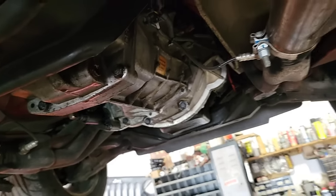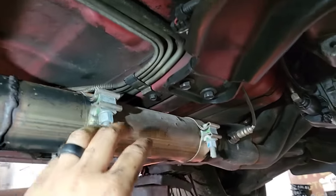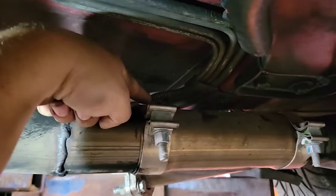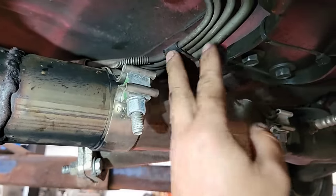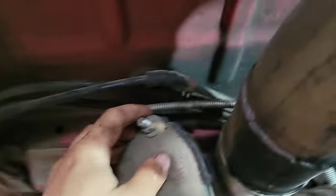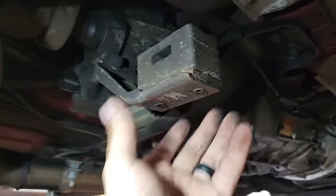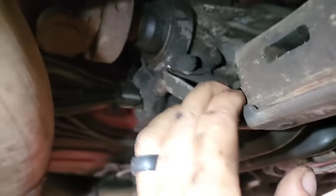Alright, it's drained. There are a few things we're going to do depending on whatever we find. One good suggestion — I got a fella here helping me — is to put an aluminum plate, sandwich something in here to go between the exhaust and the brake line. I can't even get my finger in between there, so guaranteed that brake fluid's going to be getting hot. Same with the fuel. We'll put these lines closer to the floor to get them away, and then put an aluminum plate to bridge the gap in between there, because you want to be able to stop, and you don't want to boil your gas.